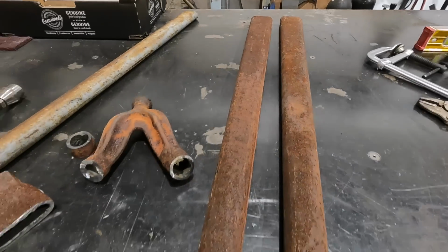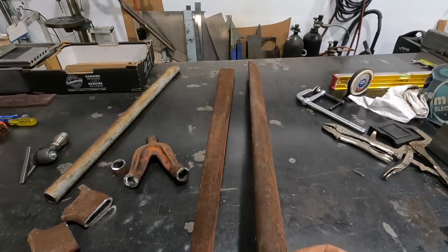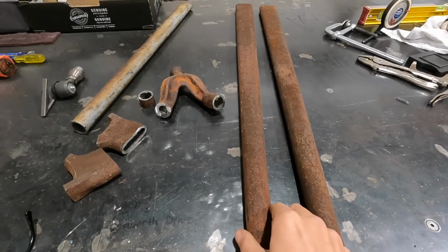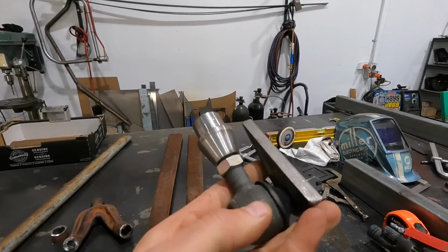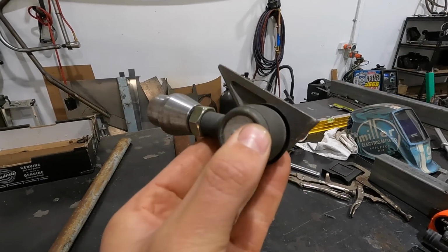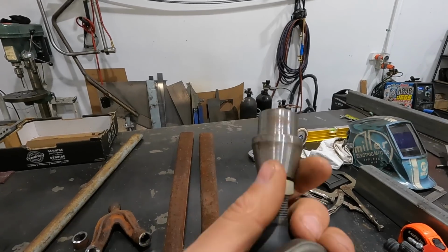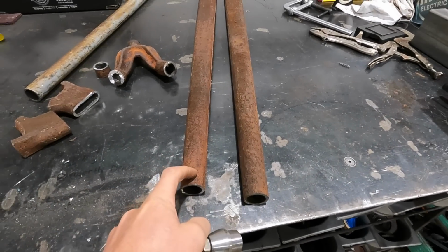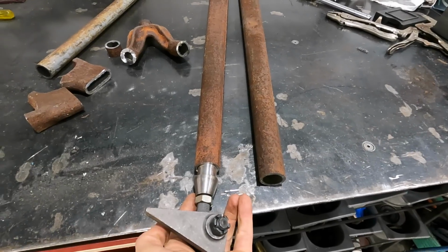All right, so there we have our split wishbones that we will end up using. This one's just got a tiny bend in it, so I'm just gonna go and put that in the press and straighten that out. But basically what we have are these little weld-in bungs, tie rods, and mounts. These were from, I think they're from TCR Components over east, but yeah, I've bought lots of parts from them. They're usually really good. So basically that's gonna be a hole drilled in so we can rosette weld it. This will obviously be ground back. We'll press these in, and that'll be the end of our tie rod.